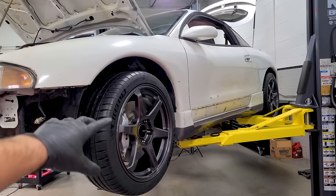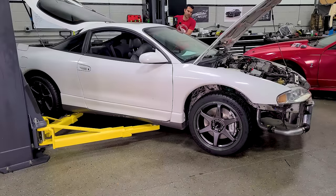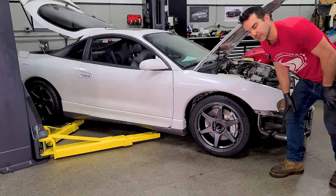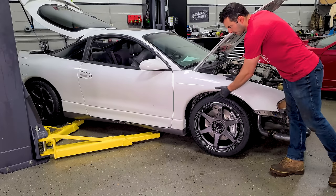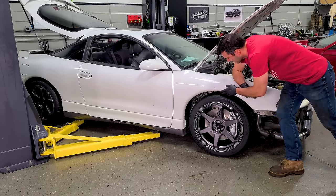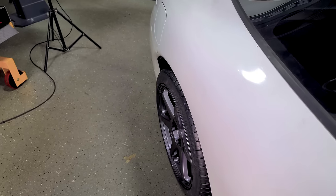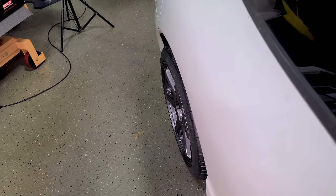Let's lower the Eclipse. About to touch down. This looks pretty good — it's coming in. This is like the factory ride height that they set it at, so we don't have too much adjusting to do. The rear is pretty good — once we lower it some more and maybe get some camber bolts, I think the rear is going to be perfect. This is the real-world poke we're dealing with, but we still have to go down quite a bit. Camber can fix this — and I'm not talking about going full blown camber gang. We're not doing that.